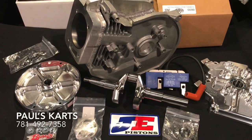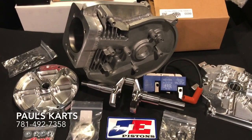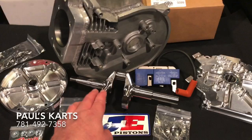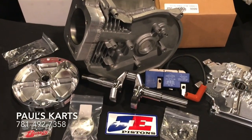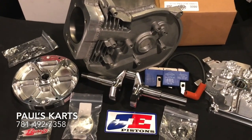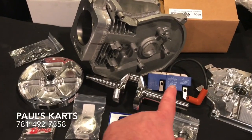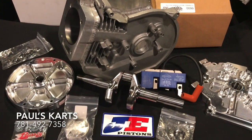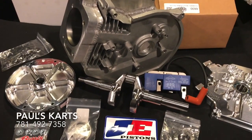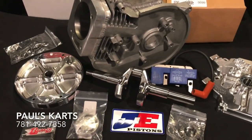Blake. So this build here, we got ARC billet stroker crank — really nice piece made by ARC. We have the ARC PVL flywheel, and that with the Briggs PVL 12,000 limiting coil — I believe that to be the most sound ignition system for these.